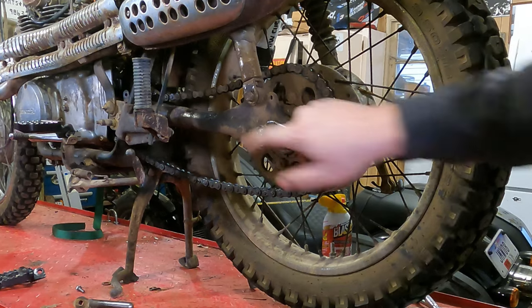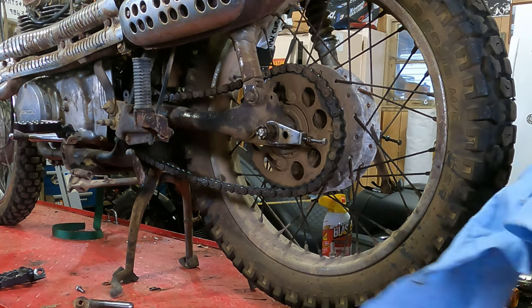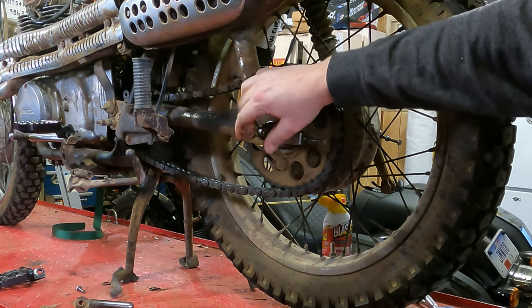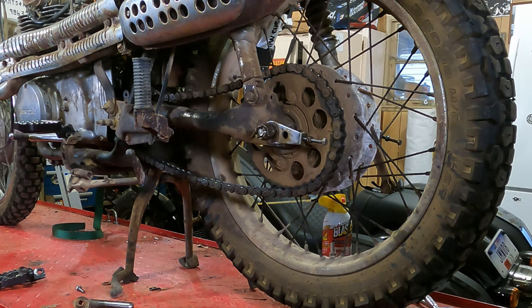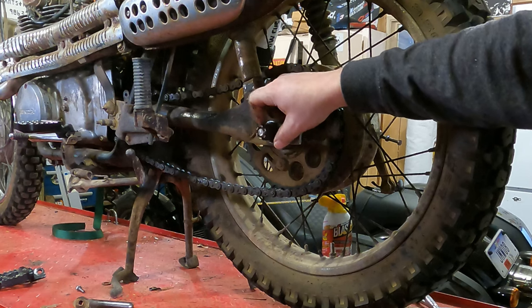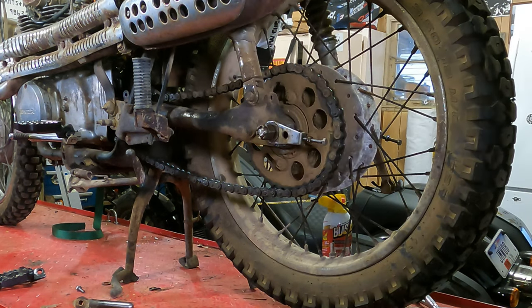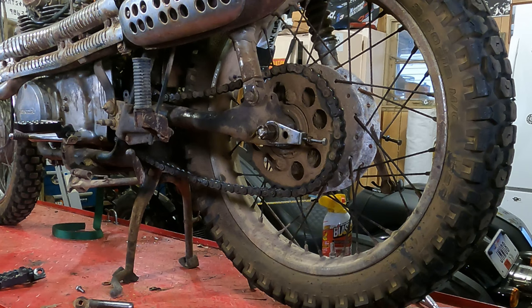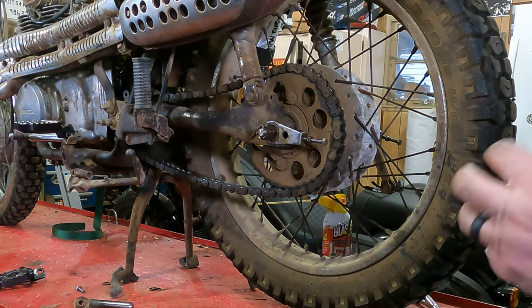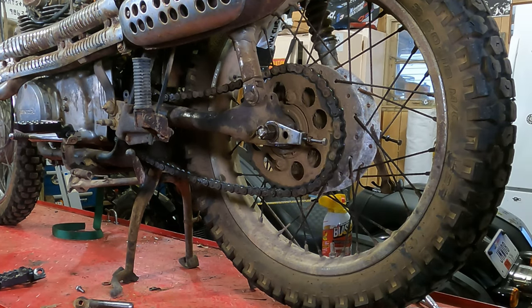You don't want to hit the end of the rear axle with a hard-face hammer because you'll mushroom the end over, and then you'll either never get the nut off or you won't get the nut back on. So what we're going to do is thread the nut out until it's flush, then take a soft-face hammer — rubber, nylon, plastic, some form of soft-face mallet — put it up here and hit that. This will break the axle free from any dried-up grease and make the rest of the removal process easier.